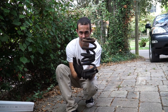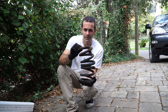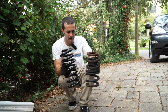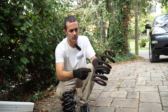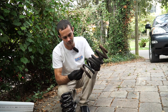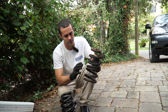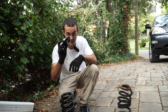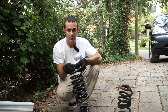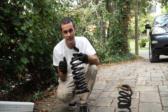That is our spring. Here's our old spring versus our new spring. Judging by how close the coils are together, I'm sure somebody heated it up to lower it — because this thing was about as low as you could go. You never want to heat your springs because that ruins the tensile strength. These also have isolators that will go on here and give us a little shock absorption between the control arm and the spring.